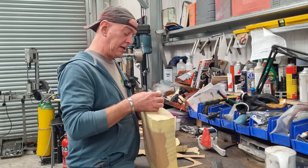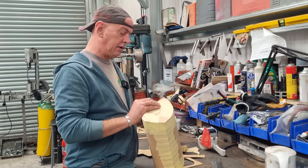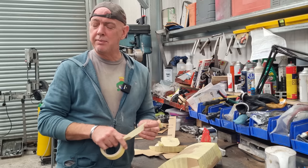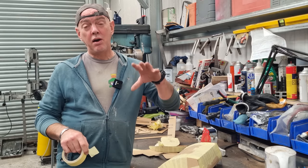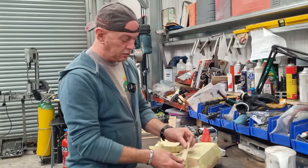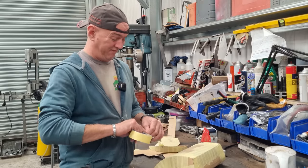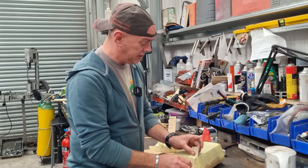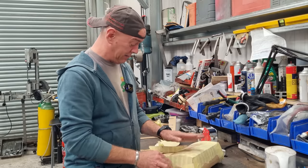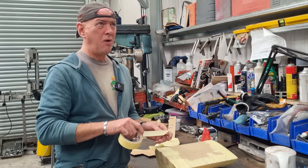So basically I took it down to Crispy's. There's a video on it all if you want to go and have a look-see. But we gave it some welly on the dyno. Properly gave it some. We had trouble with the carbs. The carb needles were sticking, they weren't moving properly, so all that lot had to come apart. But the easiest way to test it all was just to razz it up on the dyno. So in the end, he probably had like 11 runs, and they weren't gentle ones, like at all, on a freshly built engine. And I've caused damage to it, basically. I've killed it on the dyno, which is easily done. They blow up on a dyno all the time.